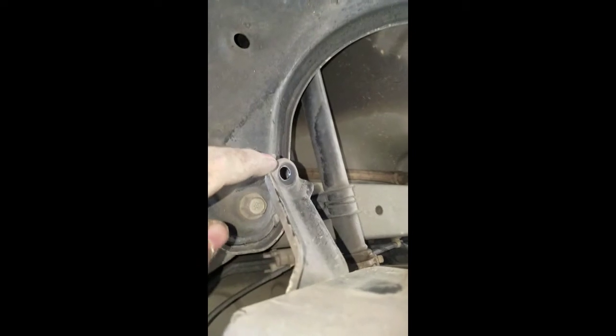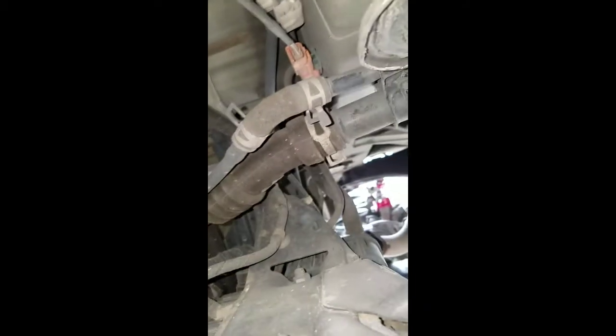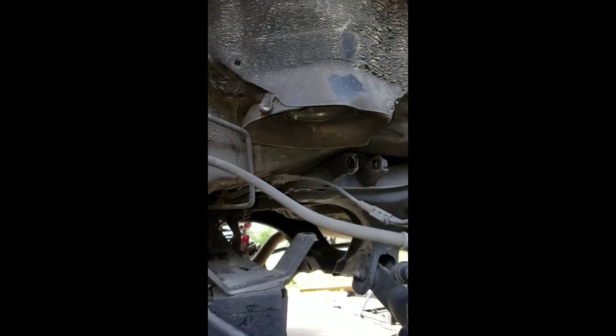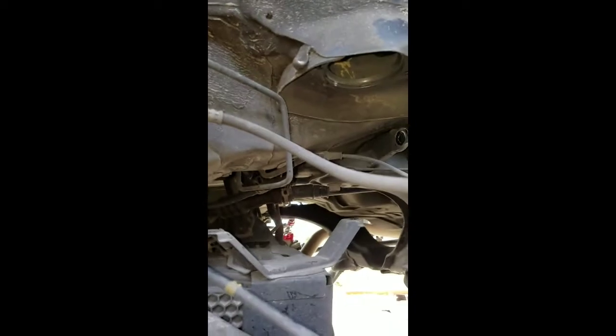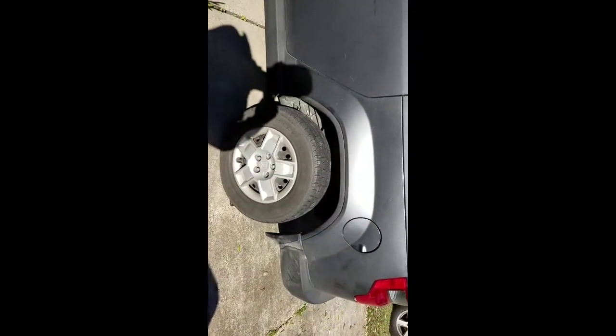On the driver's side there is this box — not sure exactly what it's for, a honeycomb-looking thing with a bracket, a nut here, a nut there, a bolt there, and another bolt further down. On the other side there's another bracket with another bolt way up there. I undid these two bolts, pushed it down a little bit and out of the way, and managed to get the strut out without fully removing it. Putting the strut with the spacer back in may require unbolting that — just a heads up.